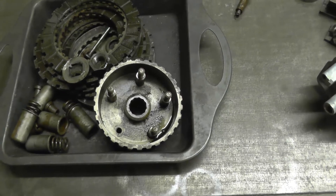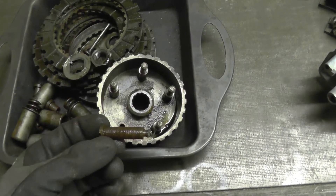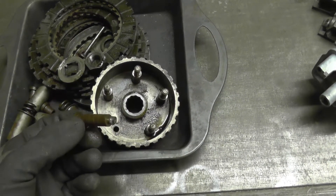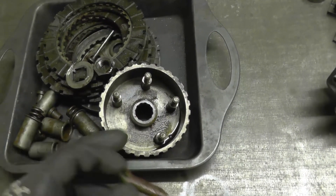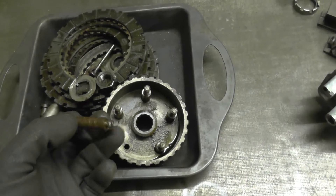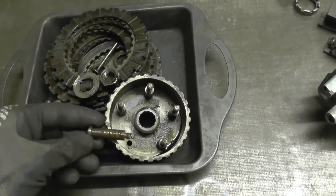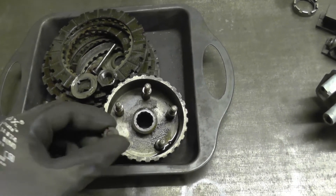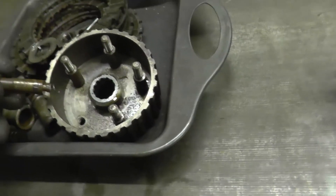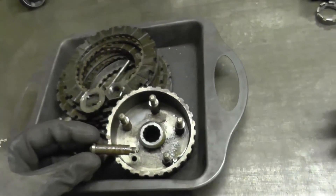The thing you don't want to happen had happened — one of the nuts was seized onto the clutch, and I couldn't get the stud out. But at least it cooperated enough to come off. What these do is they strip the thread in the hub or strip the thread on the stud, but the swaging on the back holds, so the stud just ends up rotating into the clutch hub and you can't get the clutch apart at all. You end up having to drill down the centre of the stud just to get the clutch apart, and I'll probably have to make a new stud and fit that into the hub.